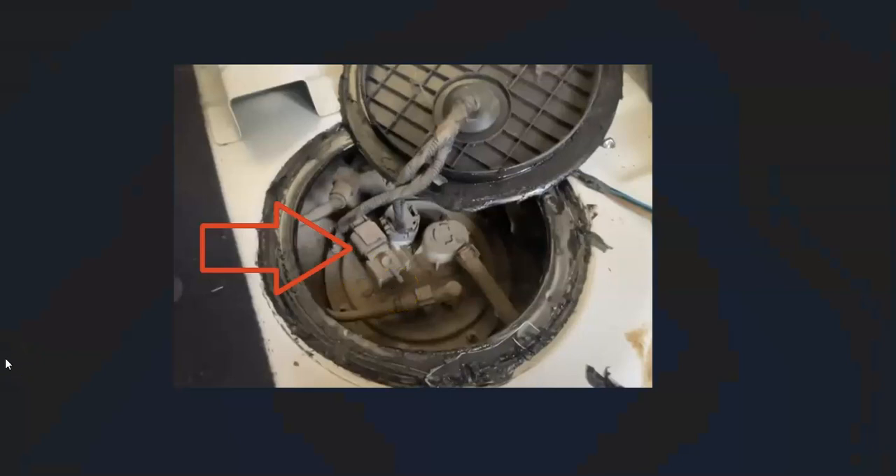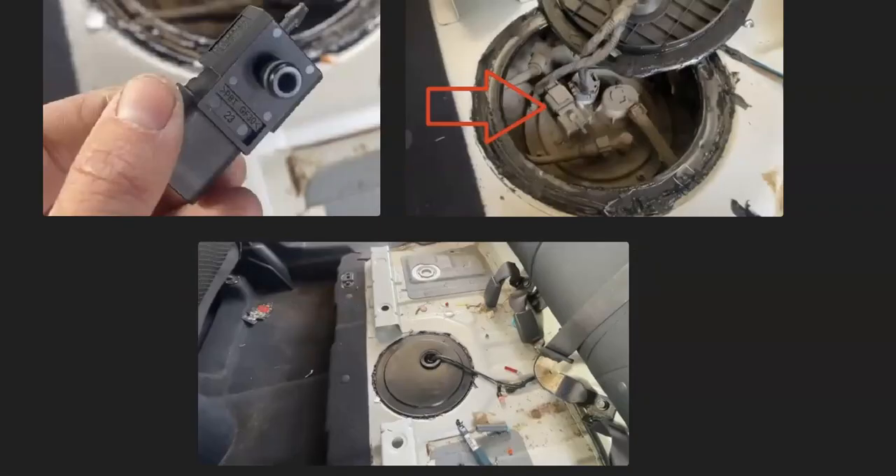If you've checked out the wiring for any opens or shorts and there's nothing like that, and there's no blown fuses, then very likely that pressure sensor has failed. That's a quick overview of how you go about fixing a Kia with the P0453 code. If you have anything to add, please comment below. If you have any questions, ask and I'll try to answer them. If this video helps you, please click like, subscribe, and have a good day.